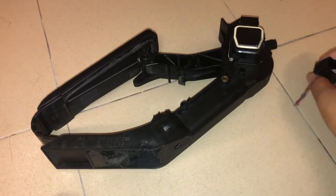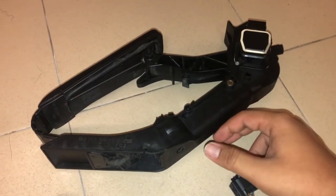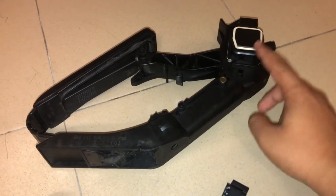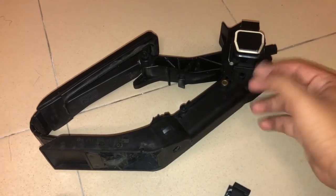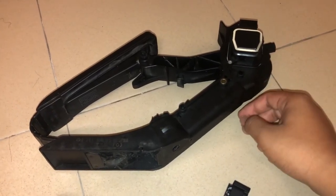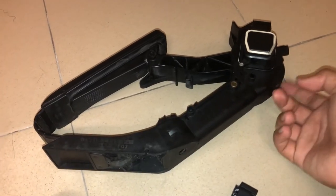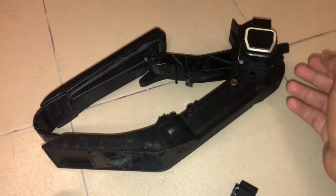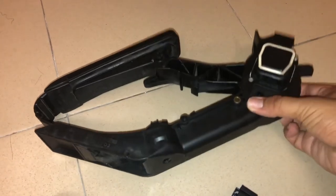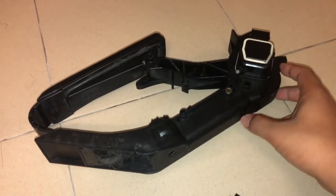When you come across the P0120 code, don't automatically think you have to change the throttle position sensor. I see people who get a replacement TPS for their Crossfire or SLK and the car runs fine — at least on video. But I also see people with the same issue as me who change the TPS and it doesn't fix anything, so they then clean their MAF sensor or throttle body and the car runs fine after that. For my case, I do need to clean my O2 sensor.